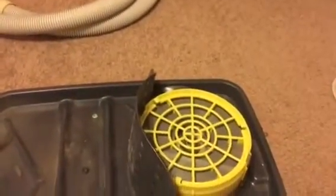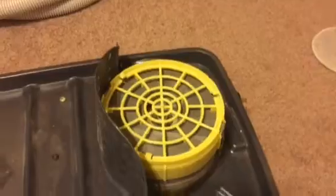So we open up the machine again, just like a clamshell. I know it's hard to do this with one hand. We'll remove the filter — the dirty filter — like so. Then we'll remove the dirty bag, like so. It's quite full — more than three quarters full. And they say to change the bags at three quarters full anyway, to maintain airflow and suction.